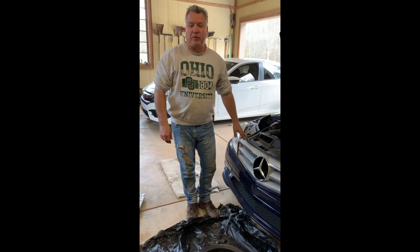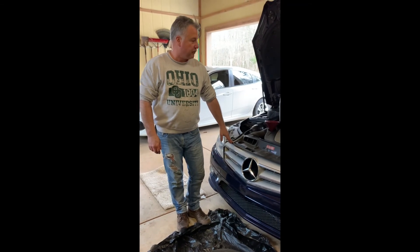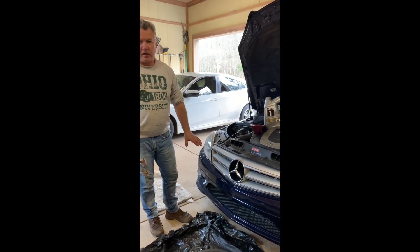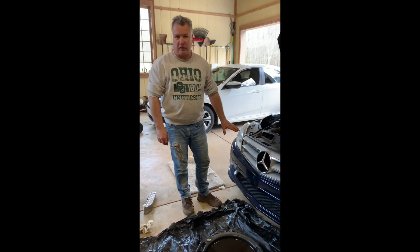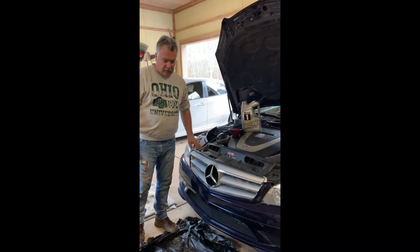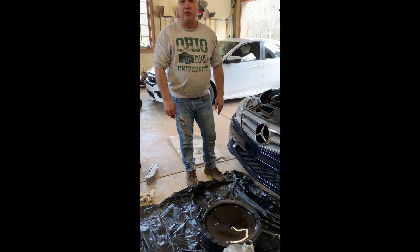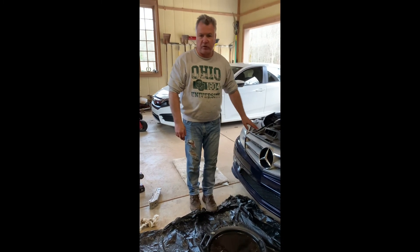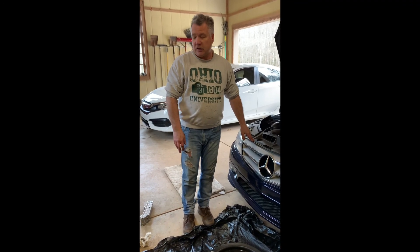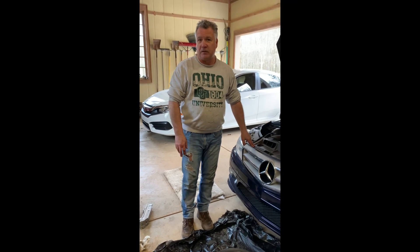We're just wrapping up the oil change on our 2008 Mercedes C350 W204. We're putting the oil back in — we dropped the car back down, put the shroud back underneath, and put the drain plug back in the oil pan. Fill it back up with nine quarts of 0W40, then take the excess oil, pour it into a container, and return it to an auto parts store to recycle it. That's all there is to it — a rather simple oil change that costs about $70 in supplies and saves you a lot of money. Hope you enjoyed the video, see you next time.